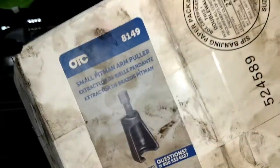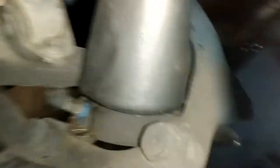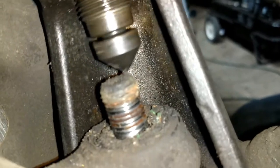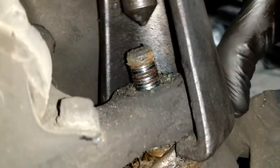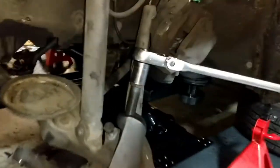This tool is OTC 8149. Here's what this tool looks like — it fits right around the arm. This screws apart like that — there's the press. See, that slips over the control arm. Then you run that down a half inch. You should see that fall when it pops loose. There we go — look at that ball joint. No good.